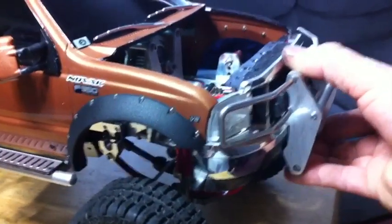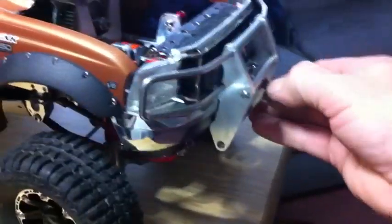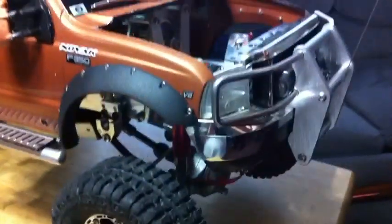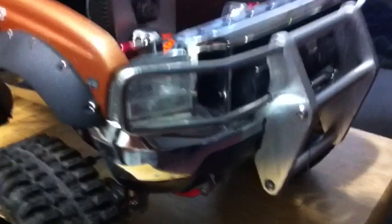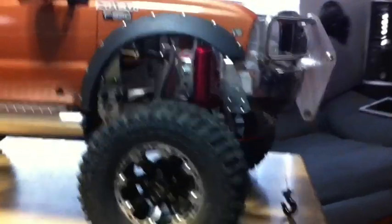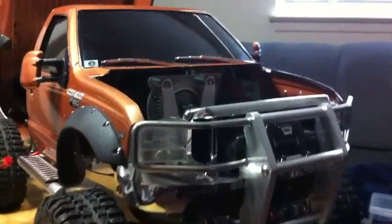This bumper is mounted — now with the hood off it's hard to see — but underneath here I used a little 90-degree bracket and mounted that onto the frame, so the bumper is solid onto the frame. If you pull on that whole bumper it is supported and you can pull with the winch, and it can support the whole weight of the truck. The winch is mounted flush way up in there, so from a side view you can't even see there's a winch — it's really clean.